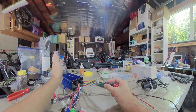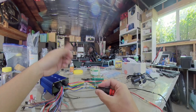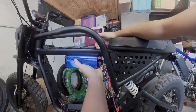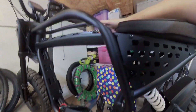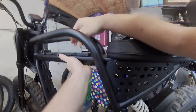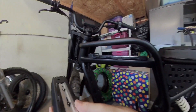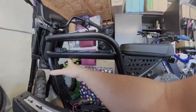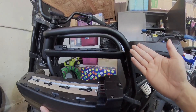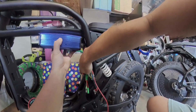I just want to reiterate and summarize. We plan on using the original display — leave this white wire and connect it back to the original controller to detect your speed. I've already pre-measured everything and planned on zip-tying it right here just as I did in my other Rev1 bike. I've already loosened this part and added a washer so a zip tie could go through there. Not only that, I'm planning on putting a 60-volt today. My 72-volt will come later when I have my storage case, which is on back order. The battery mount for both the 60-volt and 72-volt is exactly the same, so I can place the battery here with wires hidden within the frame.